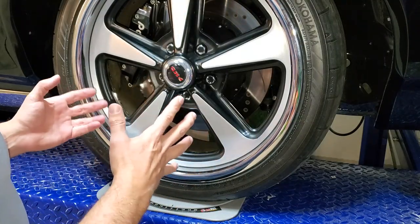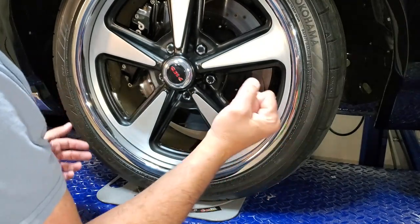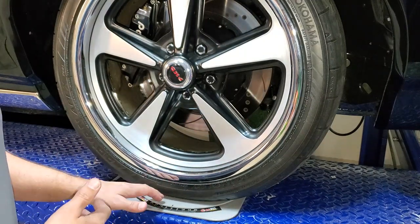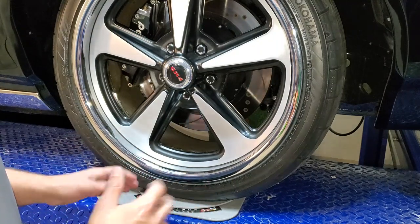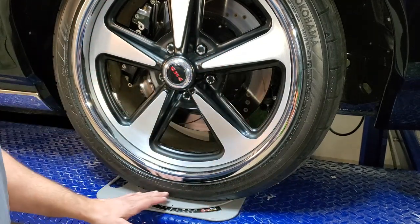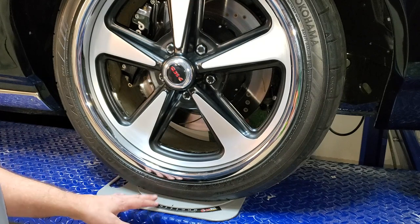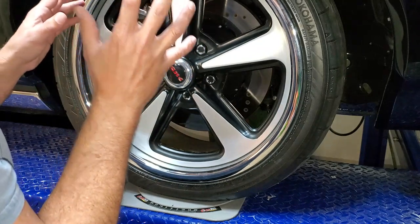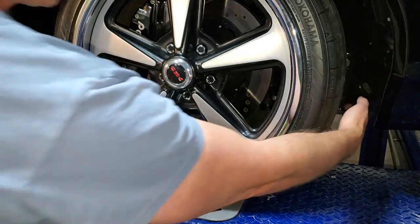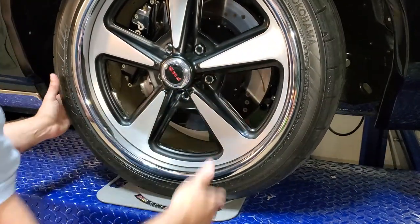Number one, we have to figure out a way to easily pivot the wheels, especially when adjusting our tie rod ends. We don't want the tie rod ends to bind because the tire isn't allowing it to swivel. Quick Trick came up with these swivel plates — also called toe plates, bearing plates. They're roll-on; you can drive onto them. They're steel, ball-bearing loaded. The weight of the car is on these two plates and I can pivot the tire — what an awesome invention.